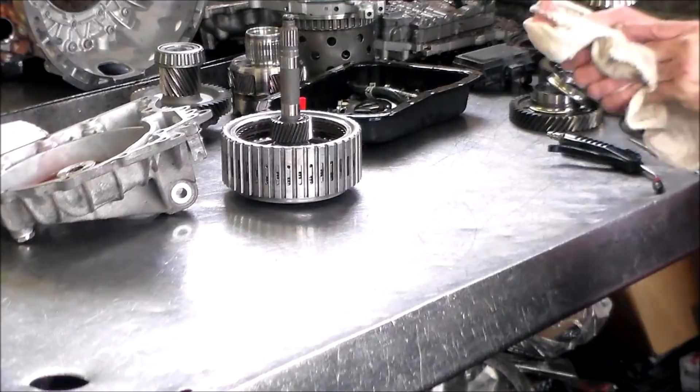Technically when this is in the car, this is the fill — you fill it from here. Then you take the plug out of the pan and here is your standpipe. You fill it until it runs out, start the car, then fill it again until it runs out. On two or three occasions, I've gotten calls from wholesale accounts saying they serviced the transmission and since they did, it's not shifting right and thrown speed sensor codes. What was happening is they were filling it until fluid ran out of the fill plug — they were probably four quarts over full. We left the plug out with the car running and drained four or five quarts out. Once it was at the proper level, it worked fine.